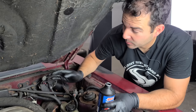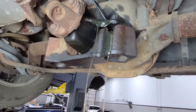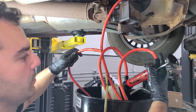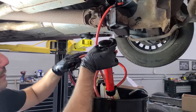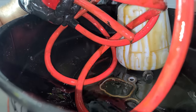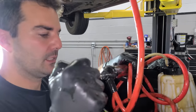We're going to go pretty far with this one and make it look brand new - replacing all this nasty deteriorated stuff and seeing what we can do with this intake. I'm super excited for that one. Even though the diff fluid looks pretty good on this car, I am going to swap it out for some better diff fluid. Instead of taking the rear cover off to drain the differential fluid - which is stupid, they should have a drain on there - we are going to suck it out with a $12 multi-use transfer pump. I have the suction end inside of the diff, and we're simply going to pump the fluid out just like that. That's going to save you a ton of time - you don't have to mess around with cleaning the diff cover, then resealing it and then potential leaks. If it's not leaking at all, don't mess with it if you just need to do a diff service.